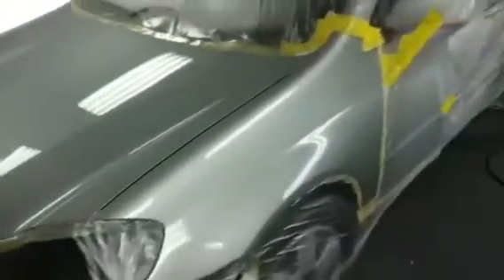This last one I got done today was fighting the waterborne base coat, just sitting on there wet. I didn't really want to get the air dryer going too much with my stacked bumpers in the corner of the booth — it tends to blow a lot of dust off no matter how well I sweep or paint the floor. So I tried a new thing: I ran my hose out, left the door cracked a little bit, plugged it in, fired it up, and that hose heated up pretty quick — got up to about 108 degrees.